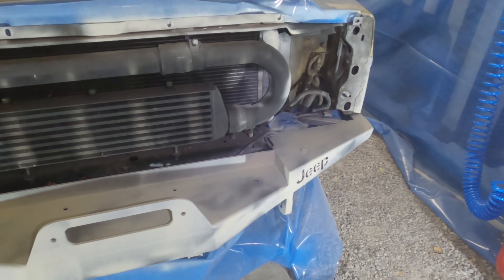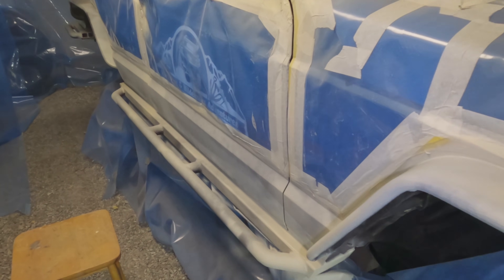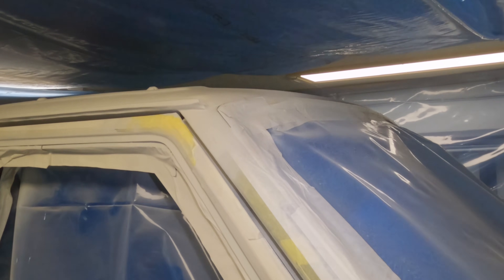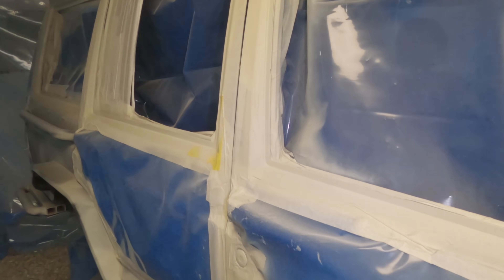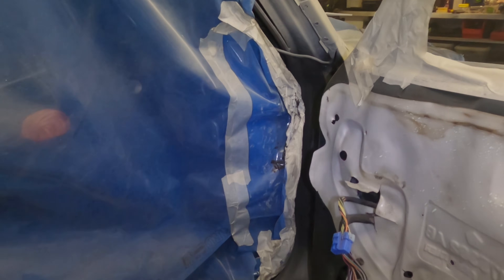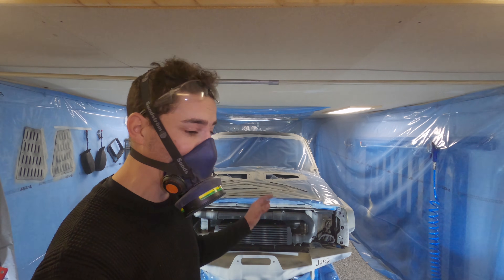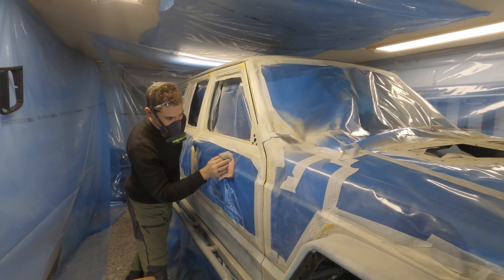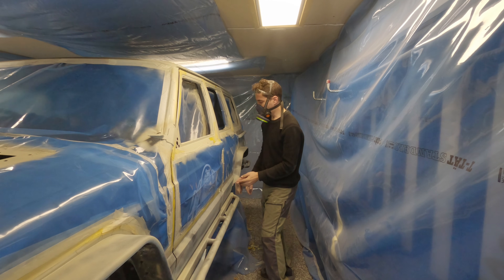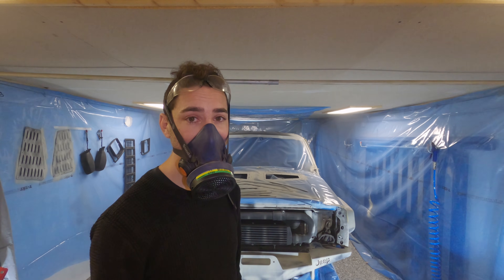I've used three cans of primer. I primed areas with OEM paint and bare metal, and ended up priming the original Raptor liner as well. That might seem like a dumb idea — if you missed a spot when spraying the Raptor liner, it wouldn't be such a big deal because you already have a dark Raptor liner coating beneath it. I just had so much primer left I thought it would help form a better bond. We're going to have to let all this dust settle now. These plastic parts we'll worry about later, and I'm going to give this a few hours, come back in, clean the area down, and then get ready to paint.